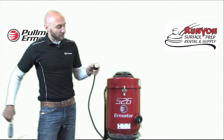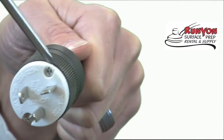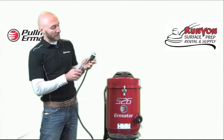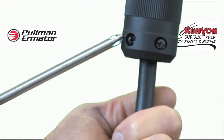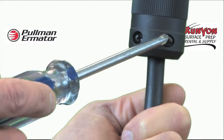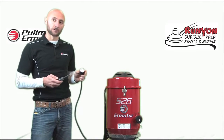There are four Phillips screws which I first need to loosen — two at the top, and then two which hold and bite the plug to the cord. I'm going to need to loosen all four of these. That's the first thing I'm going to do in order to change the plug out.